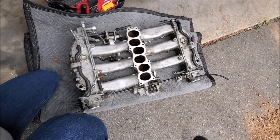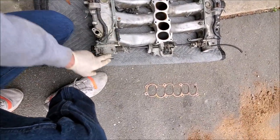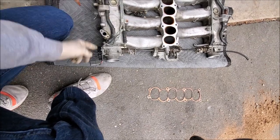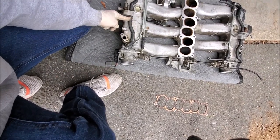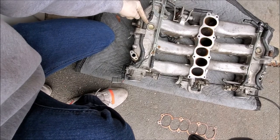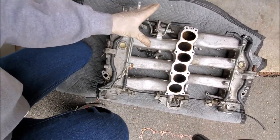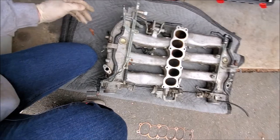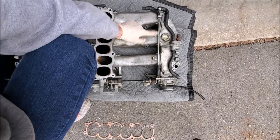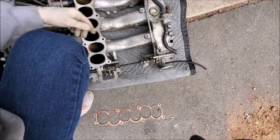The plenum gasket came off really well — I don't have to do a lot of scraping. Off the throttle bodies you're going to see this coolant line — we're deleting it. Just follow this line here, also getting deleted. Cut the line, pull them off the PCV valve area, unbolt the 10mm bolts, follow the route of where the lines go, and literally just take them off and throw them away. Same thing on the other side: 10mm bolt, 10mm bolt, cut this line, cut this line — see you later.